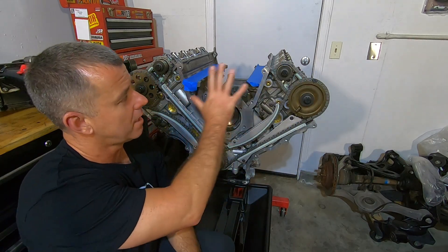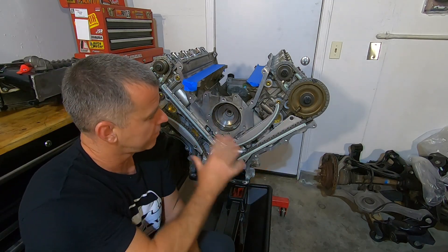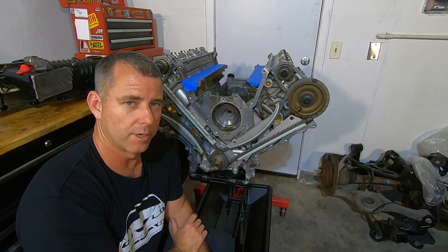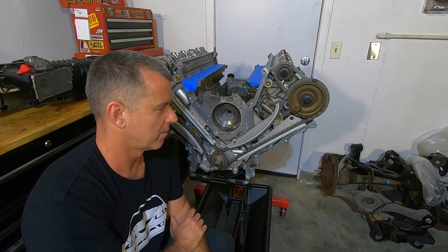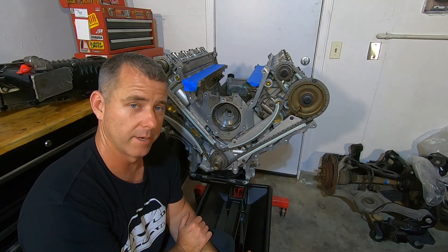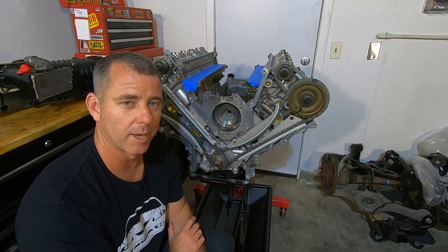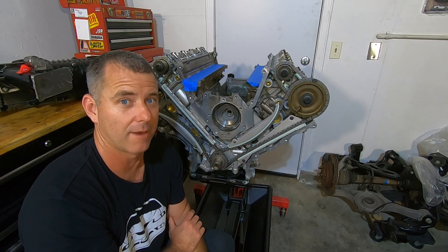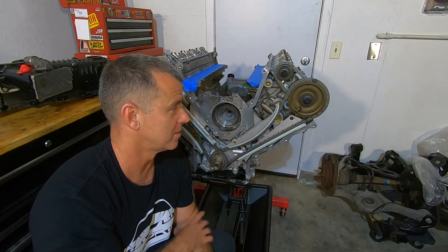In closing, there is a lot of stuff that manufacturers make for these engines, but just because somebody makes it doesn't mean you need to put it on. If the pivot arms and guides look good, reuse them. If the gaskets look good, reuse them. If the pivot arms are old, brittle, discolored, and have grooves through them, and you have the money, then I'd get a new pivot arm, guide, and a metal tensioner at a minimum. Inspect everything else and see how it is. Thanks for watching — let me know if you have any questions or comments down below, and subscribe to see more videos on Mustangs and engine building.